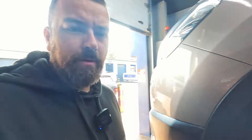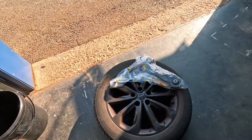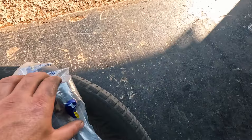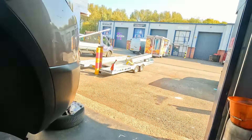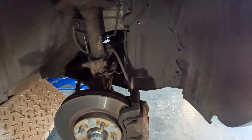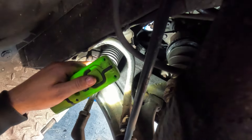Change of plan — I thought it was the nearside wishbone and left the driver's side wheel on, but it turns out the wishbone is actually the driver's side. The one that was supplied is for the passenger side, which is wrong anyway because the mounting point is different. I've sent my girlfriend and Vinnie to go and get the correct wishbone. All that's failed on this one is a little rip in that dust cover. For now I'm going to go around the other side and fix the steering rack gaitor.